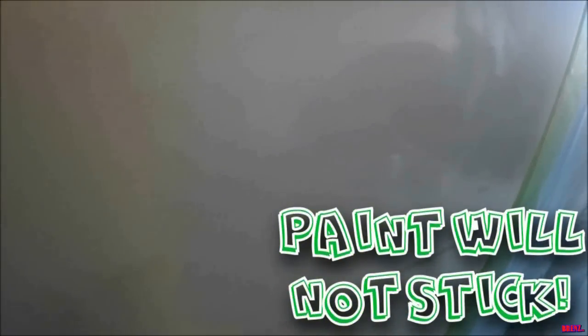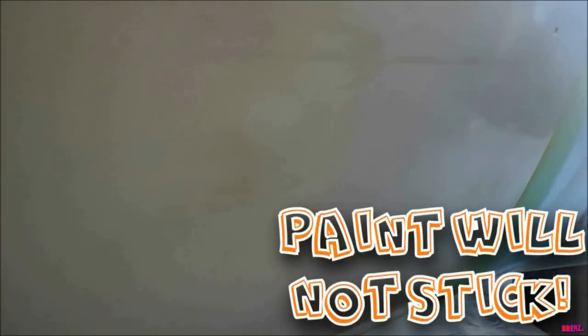It's going to be a joy painting these handles — always remove everything you can. Look at the shine in there. It's actually a bad idea to wet sand and paint in the same day because all of that stuff will get in the cracks. I don't have much choice today, so make sure you stay away from all these cracks and don't let water get in there. When you go to paint, all these things have to be blown out perfectly, otherwise you're just wasting your time.